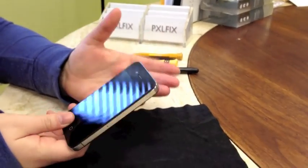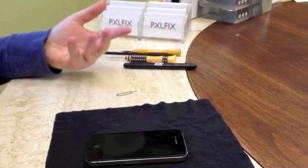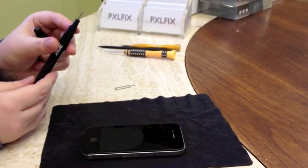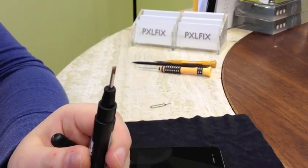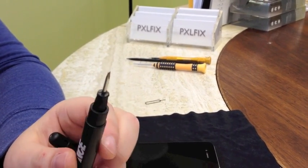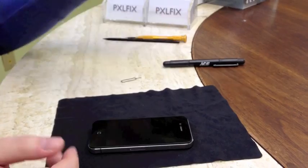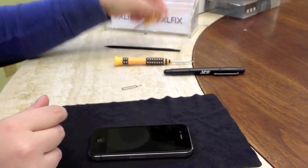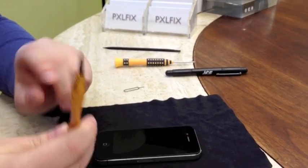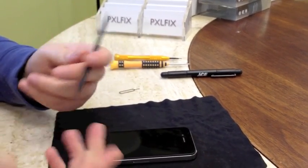The first thing we're going to want to do is take out the SIM card, but first we'll point out what tools you're going to need. You're going to need a SIM removal tool or paper clip — either one will work. You're going to need a flat head screwdriver — you need these for the logic board screws. They're kind of little unicorn screws; they actually have cross heads on them but a flat head will work to take them out. In the GSM model, you only have one to worry about. A double-zero Phillips screwdriver — you'll need a security screwdriver if your phone is one of the newer ones with the five-point screws as opposed to standard Phillips screws. And a pry tool or spudger — a plastic pry tool will work just as well.